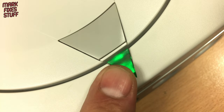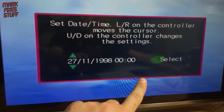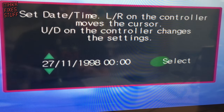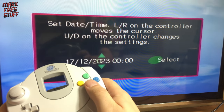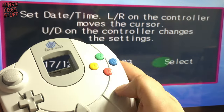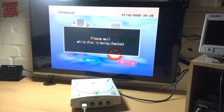This is just for fun and can be any colour, or simply left original. The Dreamcast naturally boots into the date and time setting screen. Happily, our controller is now working, so we set today's date. Bear in mind that the ML2032 battery is rechargeable and will need a good hour or so of the console being powered on to become charged. If you reboot straight away, you'll be prompted for the time and date again. And we are finished.